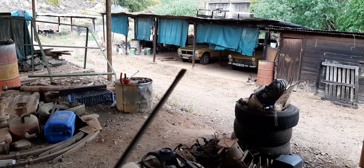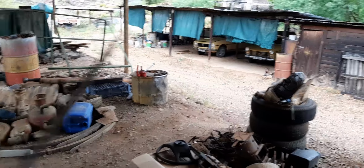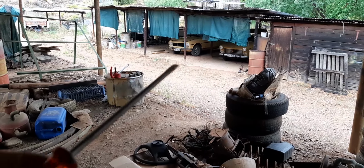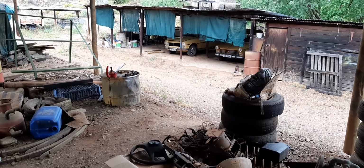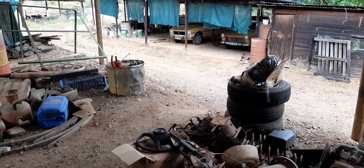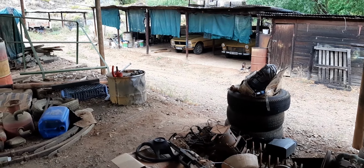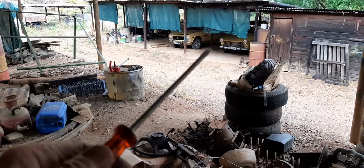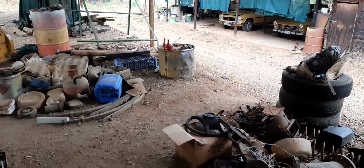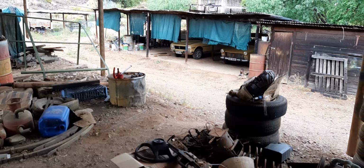So I had to make up the mountings to accommodate the gearboxes. To accommodate the gearboxes, I had to change the mountings. There is a video about that, long ago, about the gearbox mountings on the yellow pickup and the station wagon. I had to cut the floor out to get the mountings fitted.